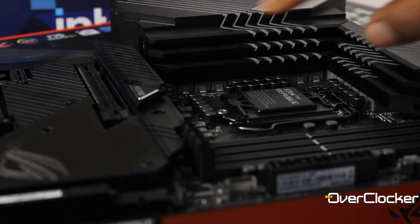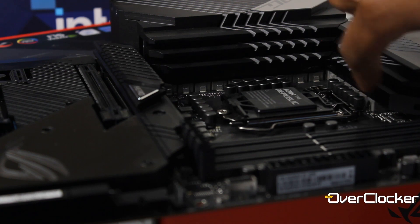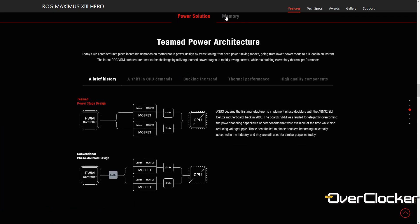One of the big selling points for me with this motherboard is just how well built it is component-wise. It's a 16-phase power circuit — 14 phases for the Vcore and two phases for the SoC. The power stages are around 90 amps for the CPU and about 70 amps for the SoC. The important bit is that you can push over 1,200 amps to your CPU — you're not going to need that even with extreme overclocking, but it's nice to know they've built such a robust power system.